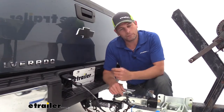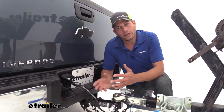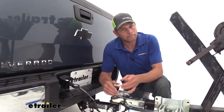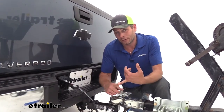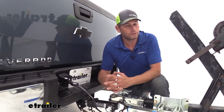If you wanted to upgrade slightly and have some more adaptability available, I might go with the Hopkins 78118 — that's a 7-pole to 5-pole adapter. That fifth pole can be important if you want to run reverse lights on your trailer, so when you hit reverse in your truck, the lights come on the trailer and you can see where you're going.